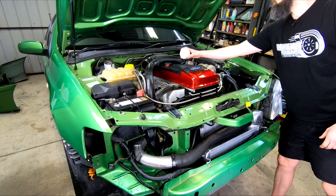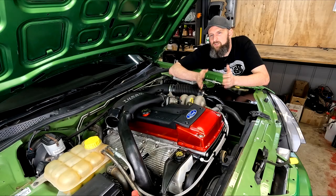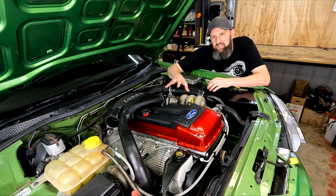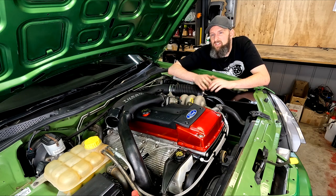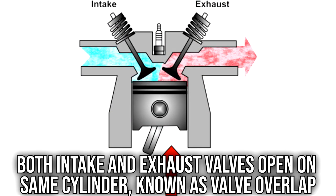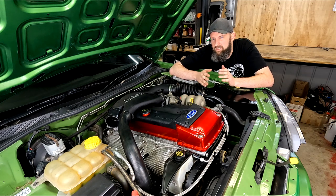I haven't done this because I'm hoping to test the whole system, but this does have a drawback. Without getting too technical, we are pretty much guaranteed to have a leak with air still getting past the throttle body and into the cylinders because odds are an intake valve will be open or partially open. And depending on the engine and cam specs, you may have an exhaust valve open as well, letting some pressure straight out the exhaust, or a little may even pass the piston rings and into the crankcase. I don't want to go too crazy trying to stop this.